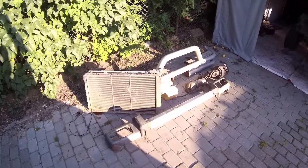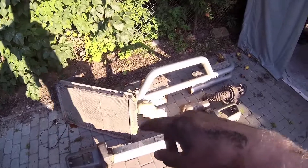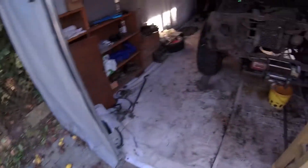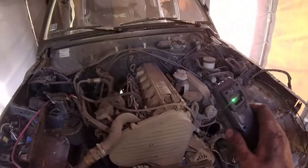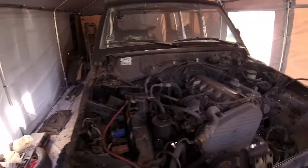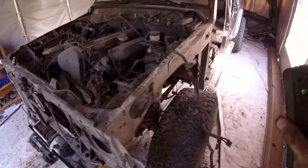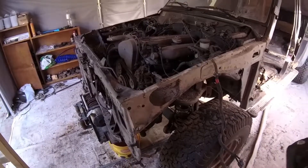So we are finished for today. Did a lot of good things — removed front and rear bumpers together with my brother, then I removed the radiator with all the wiring, the windshield washer reservoir, coolant reservoirs, and air filter. That gave us a lot of free space. To remove the engine now I need to remove the coolant tubes from everywhere, the oil system, fuel system, and still need to remove the gas tank. I'll probably remove the body first — that'll make it much easier.